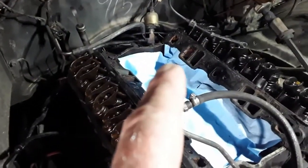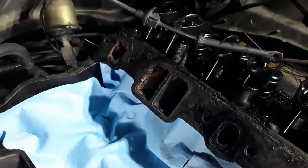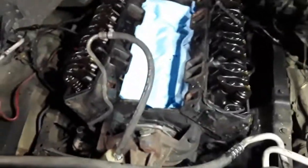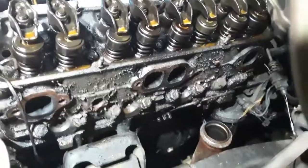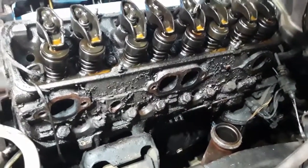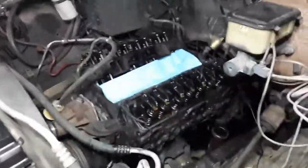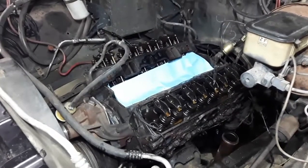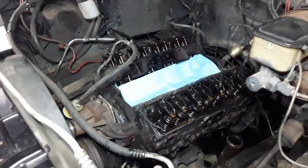Part of my problem — I'm not sure how well it shows on camera — is that back there the intake gasket's water port was allowing coolant over into the intake port of the head. But since I'm this far into it, I'm going to go ahead and pull the heads off. Looking at the side of this head, those two center exhaust ports are pretty damp, so I'm interested to see if I have water down in one or both of those cylinders. Quick update — hope you all appreciate it; please stay tuned.